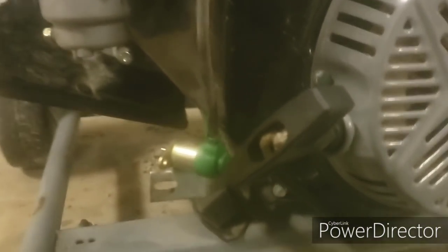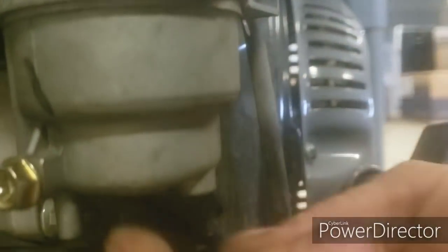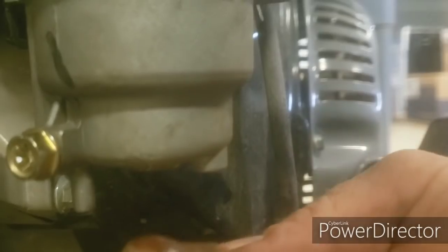Well, sorry guys, but I skipped a step because Mr. South Sass Farmer gave a guy a call. But anyways, I got the bowl back on. So this was here, down to here. This is where the float goes in here. Pushes the needle up, which shuts the gas flow off. And underneath here is that other piece that we cleaned out. If you can see it or not.